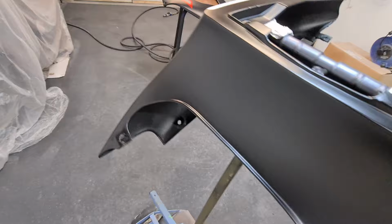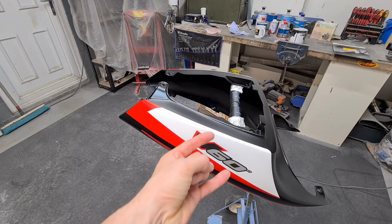And when I painted it, those weren't on. I'll just come back in and notice them. So, good. But, you know, painting isn't without its problems. I get problems mostly every time I paint something. I get it right in the end. The only way for me to correct that is to let that cure and then wet sand that little bubble out. And what I would have to do with it is mask it up carefully and blend some white in there and re-clear it. But we're going to see what we can do.